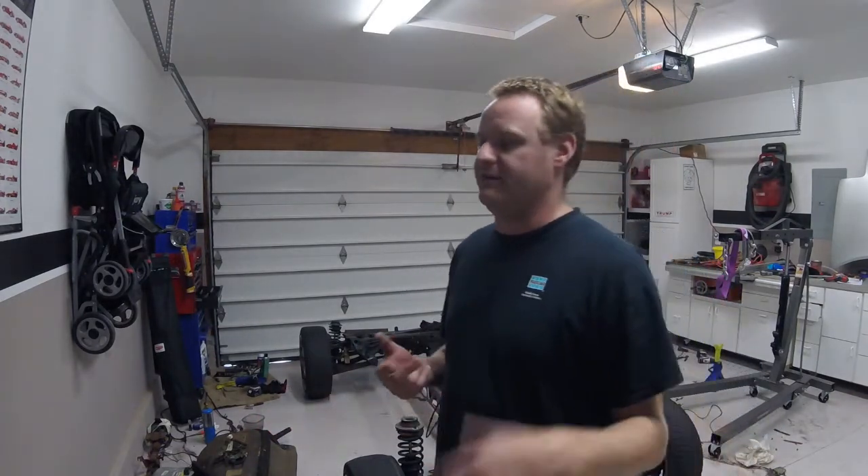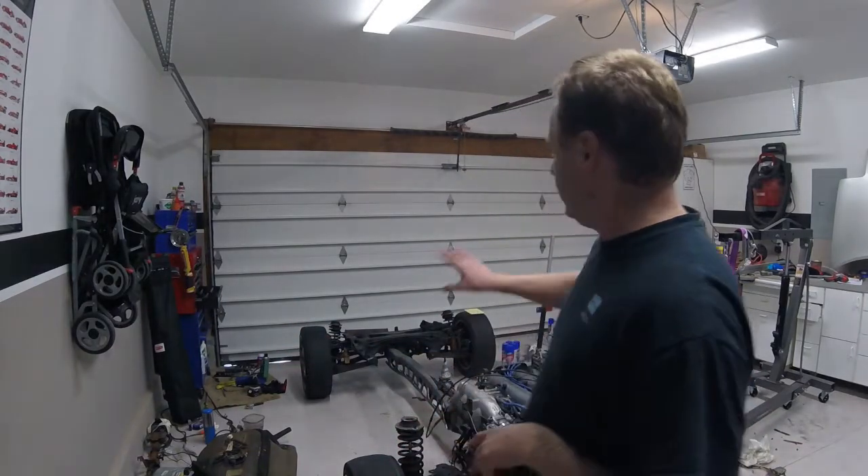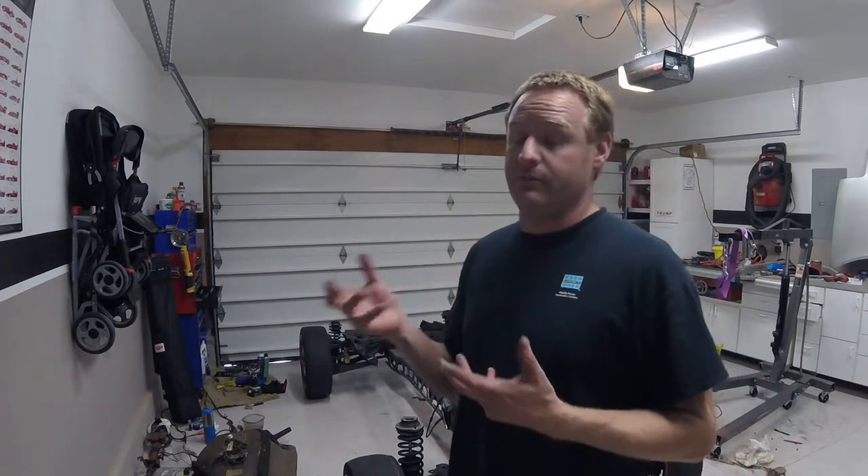Cars like this I do not ever drive in the rain or any weather, so I don't have the issue of grease deteriorating and having to pull it all apart and re-grease or put Zerk fittings in. This car is going to be driven maybe 500 miles a year and never in inclement weather. After I get the rear end done, I'm going to do new coilovers all around — probably adjustable height but not adjustable dampening. On a sub-thousand-dollar set of coilovers for a mainly street car, I'd rather invest in good shocks and dampeners with a proper spring rate and a matched damper-and-spring set.